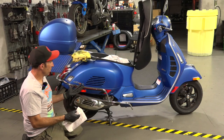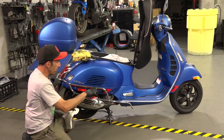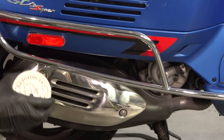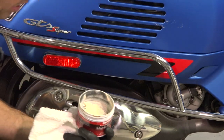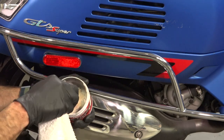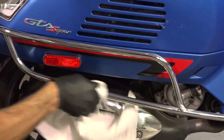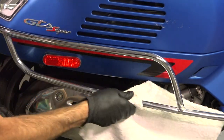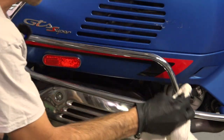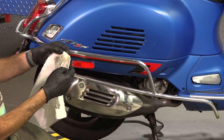After you clean the whole body of the scooter, next I go to all the bright work — the chrome finished parts. This Mother's Mag works on chrome-plated steel, chrome plastic, and polished stainless steel like the muffler guards. You only need a small amount; I'm starting with a terry cloth here. With a round rod you just buff it on. Not only does it shine, you're putting a small amount of protection on there. This is especially important if you live in a wet environment or near the coast — once you get pits in the chrome, it's a lot harder to correct.